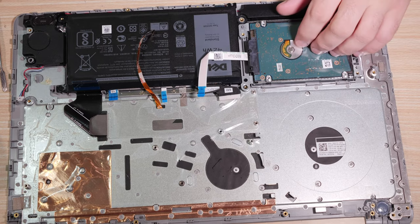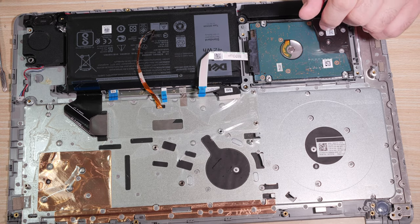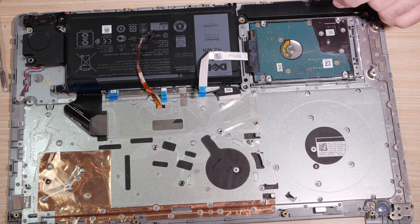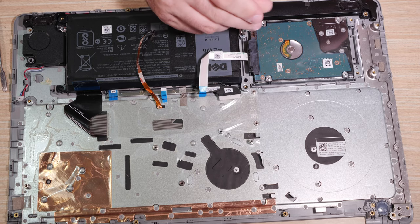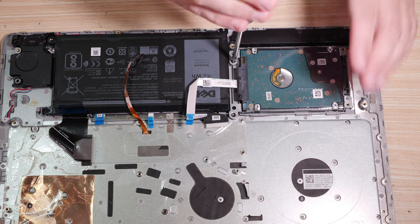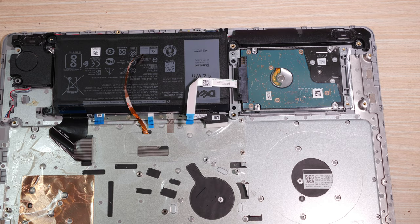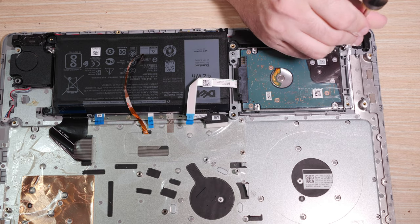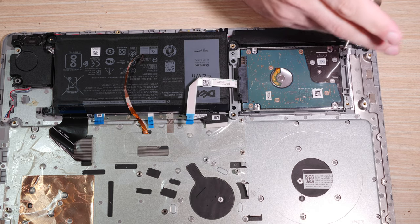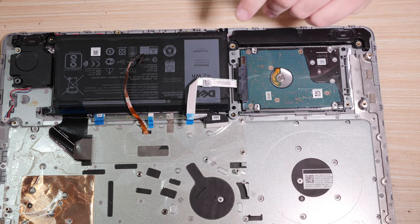This would be an opportune moment to do a solid state drive upgrade. Real opportune moment, but right now they're already paying so much for this and they're so impatient for it because they really need their computer today that we're probably not selling any solid state drives today. Let's go ahead and get this hard drive caddy down. There's three screws. The more structural kind, not the thin kind, not the long case kind.